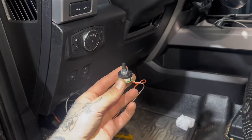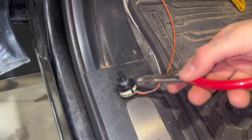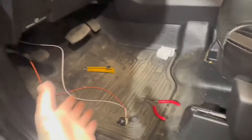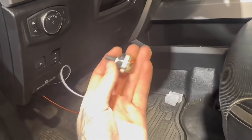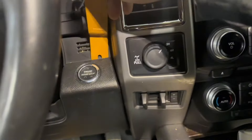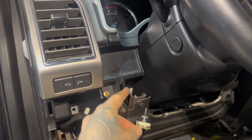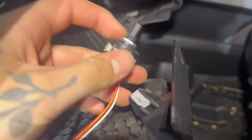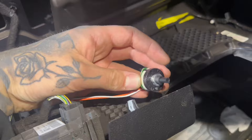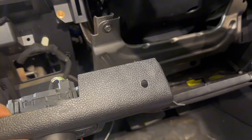Now we're going to get this switch ready for install. First, cut off that little nipple on the right side using side cutters — you can see it's gone. Now we're ready to mount the switch. I like to mount it right here on the dash panel — you can pick anywhere in the truck as long as you have room behind the mounting location. Use an upholstery tool to pop out the panel. The switch mounts right in the middle with enough room from the steering column and away from the clip. Grab a 3/8 drill bit and drill a hole right in the center.